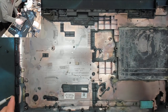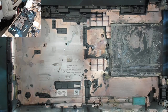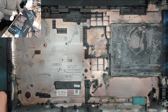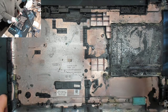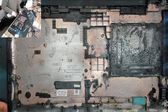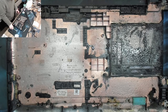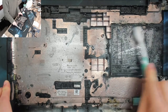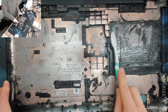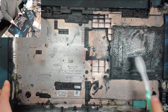For the main case I'm going to use glass cleaner because it's all plastic and I can use something a bit more aggressive. Glass cleaner is more water-based so it's not electronics-safe per se, but you can use it on electronics as long as you dry properly. Alcohol is safer on electronics, but on plastic the glass cleaner is a more effective cleaning agent — so use it where you can, but if you're on electronics, alcohol is always better.